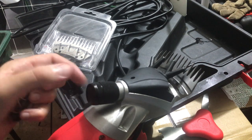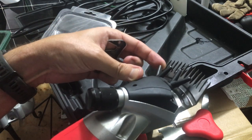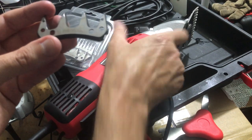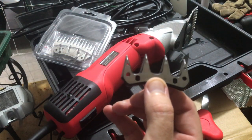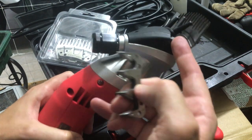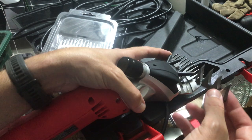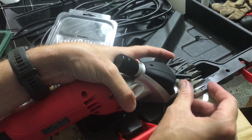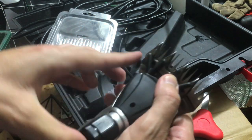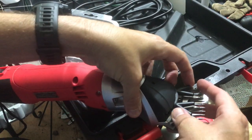It's not that it's broken — it's just a matter of putting it back on. The way I think is the easiest way to do it is to make sure your tension knob is as loose as you can get it, and what that's going to do is give you a little bit of play in this arm here — that's why the blade came off to begin with. When you look at the small blade you're going to see there's a couple different sets of holes. The ones you're mostly interested in are the two smaller ones up at the top, because if you can line those up on the arm, the bottom blade should also line up with the bottom of the arm. I'm going to use one finger, pull the arm back a little bit, and slide the small cutting blade back underneath the arm.